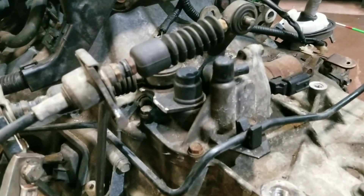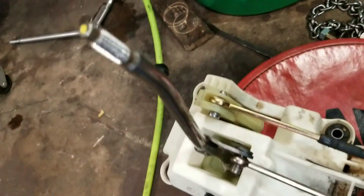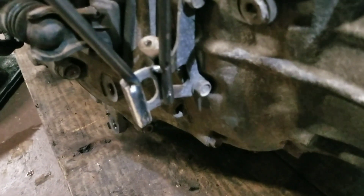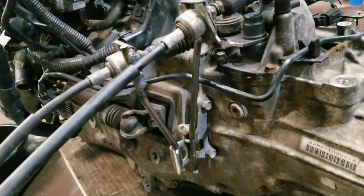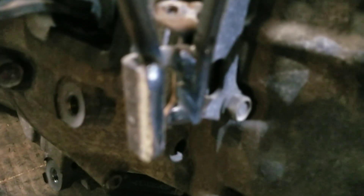The shifter is pretty much where I wanted it - measurements are good, everything's pretty centered on the shifter itself. I just made a small tack there and a tack down here so I can take my vice grip out and it should stay in place. Now I'm just gonna finish welding the two braces and make some more bracing across the bottom, then we'll see how solid it is.